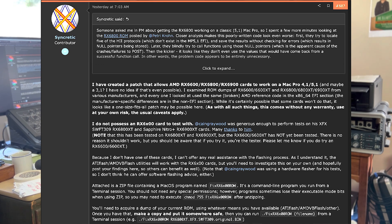The fact is, you can now run these in Monterey on the Mac Pro 5.1. This is a patch for the ROM of the video card that, when you do it correctly, you should be able to run OpenCore and run these newer GPUs.